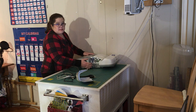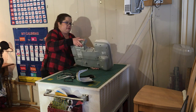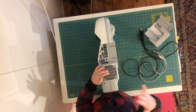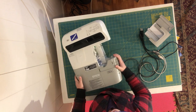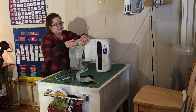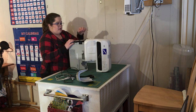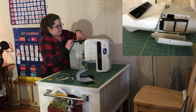Okay, so right here next to the ports is my fan. That's where the hot air is going to blow out that keeps my projector cool and working. So I want to make sure that that is free and able to move air. It comes from the opposite side of it, where there's this little door where if I push this button down and kind of get my fingernails in there and pull this up, I see the filter, which I can remove and clean if it needs.